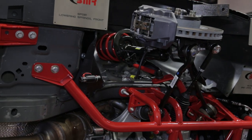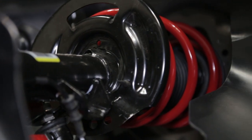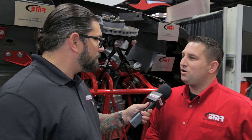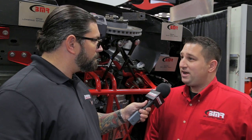But of course there's gonna be the guy out there that wants to go drag racing. What do you got for that guy? Yeah, we have a lot for that guy — we do a lot for that guy historically. We've got a front spring with the same drop of inch and a quarter, but the front rate is 150 pounds. It's a taller spring so you get a good amount of stored energy. When you go to launch the car the nose comes up and everything works really well. In the back we have a stiffer 800 pound spring to make the IRS really work the way it's supposed to. This is a very dedicated setup — if you are not a drag racer and don't go to the track on a regular basis, this is not the spring for you. Go back to that street performance spring. This is for the hardcore guy who wants to get the most out of his 2015 Mustang.